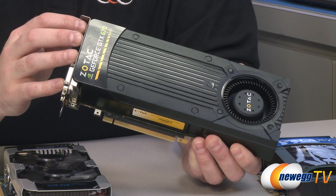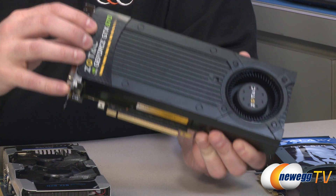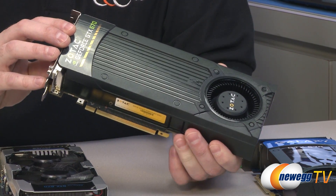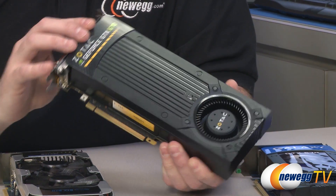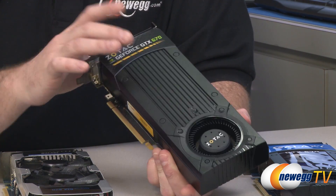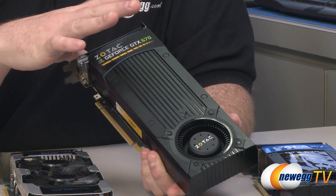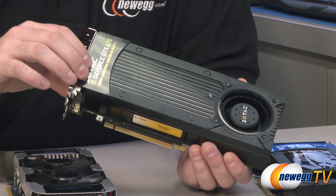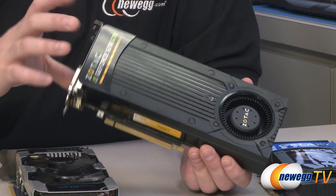The unique thing I've noticed in testing is that the listed boost clock — such as 980 MHz on these stock cards — will vary on a card-by-card basis. The GPU will actually boost itself beyond the listed specs on the box. NVIDIA has been fairly conservative listing the boost clock, because even with these reference cards I've been seeing boost clocks stable under testing loads of up to 100 MHz higher — up in the 1080 MHz range when listed at 980 MHz.